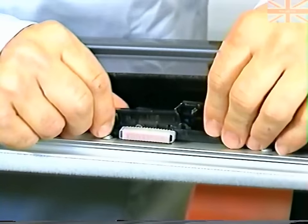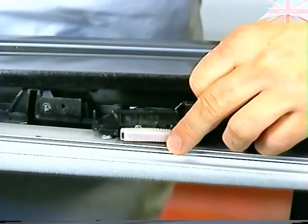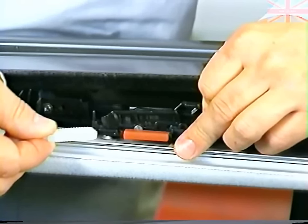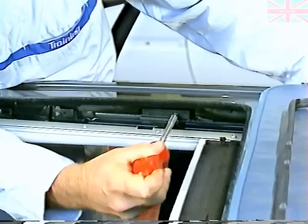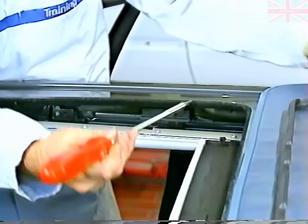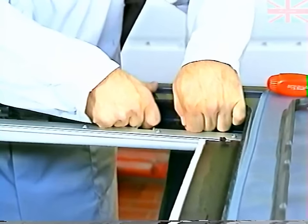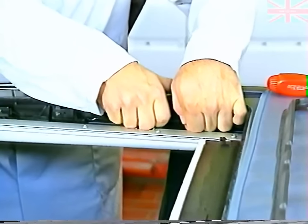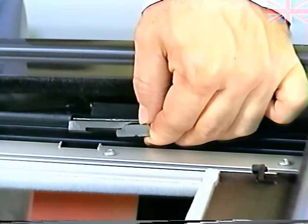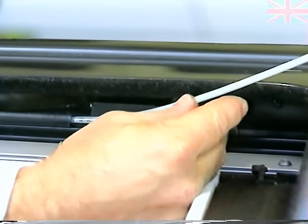The sliding blocks are a Teflon material and can be replaced separately. The tracks and blocks should not be lubricated. The access flap for the sliding roof cable can be completely removed by pulling it straight up, in contrast to the Model 202, where the flap is hinged. The final step in the disassembly procedure is the removal of the cables.